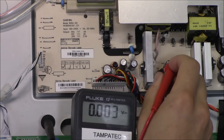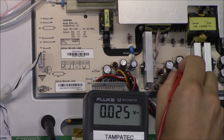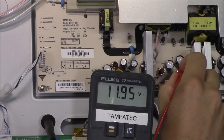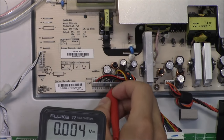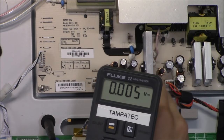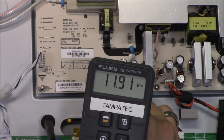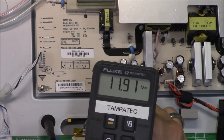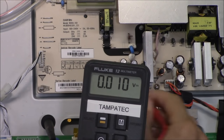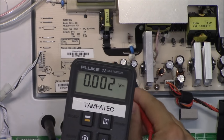Let's go ahead and turn the TV on. I'm now reading 11.95 volts — really close to 12. We should get the same voltage out of the connector as well. On the 12 volt line labeled on the plug, I'm reading 11.91 and it's steady — that's good. Now if it was jumping up and down, I would change out the 12 volt voltage regulator if it was fluctuating, or maybe the capacitors in circuit with the 12 volt line.